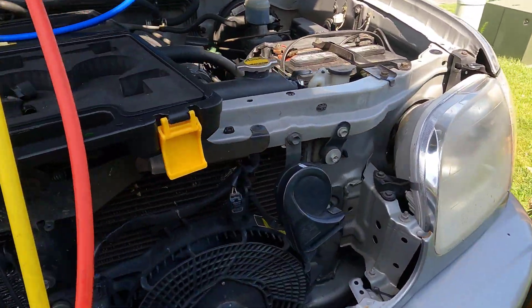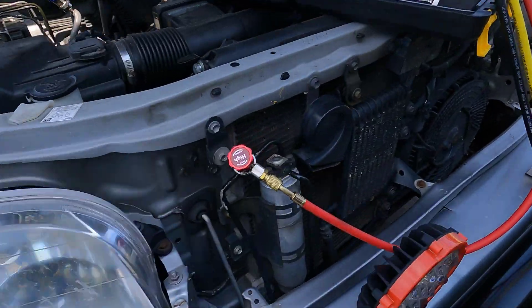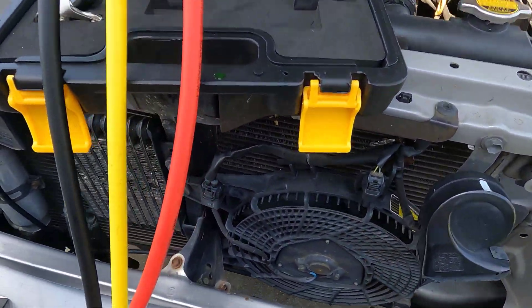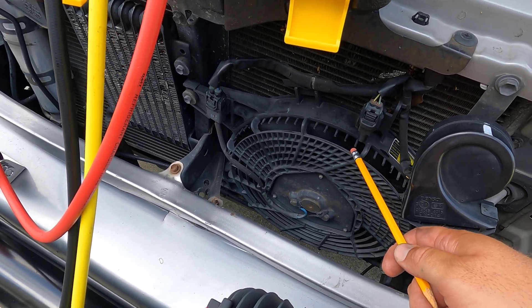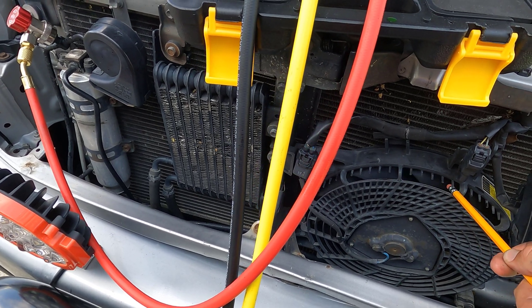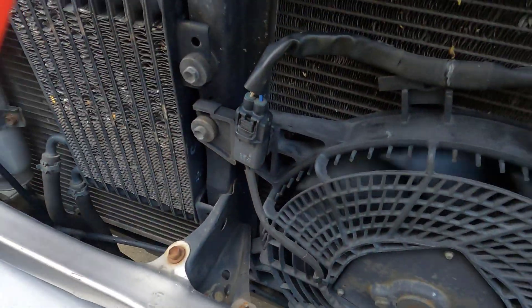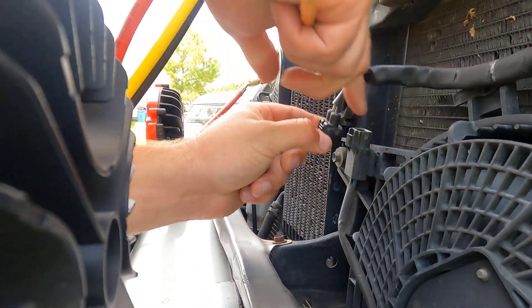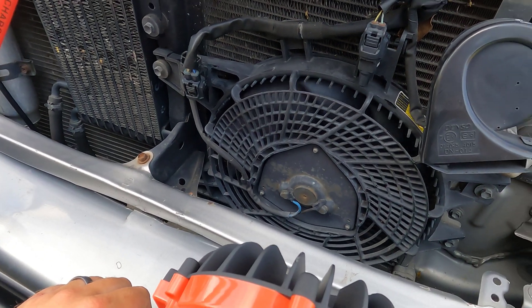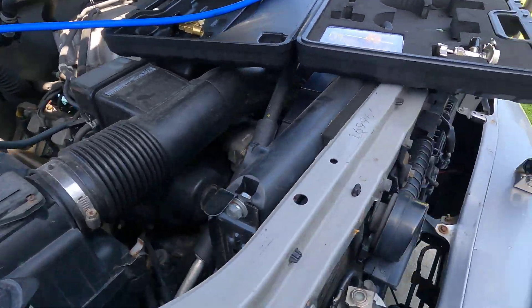The issue we're having is that despite this fan looking like it's spinning, I don't believe I have a low cooling issue — I'm getting pressure. Since I'm losing cold air at idle, I'm wondering if it's a fan issue. I don't advise this at home, guys. I thought it was spinning and coming on because it does look like it's going pretty quick, but I'm wondering if the engine fan is causing this to spin. I don't think this is going on its own. The way to check this is to just unplug the fan. Now the fan's unplugged and she's still freewheeling. There you have it — the fan is not getting kicked on.